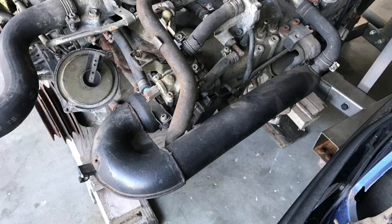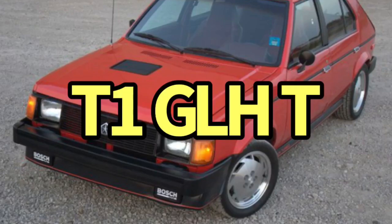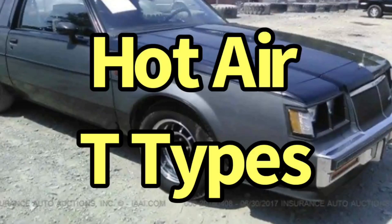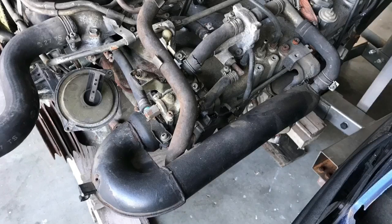The problem with not having an intercooler is the safety margin against detonation, but also lack of power. As we saw with the Dodge 2.2 and 2.5 stuff and with the Buick Grand National hot-air motors, once you add an intercooler to those applications you can run a lot more boost, you gain power even at the same boost level, and you can run more timing. So having no factory intercooler on the 280ZX is a big check mark against it.